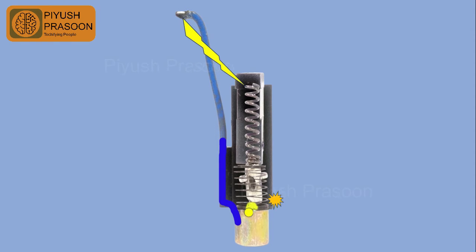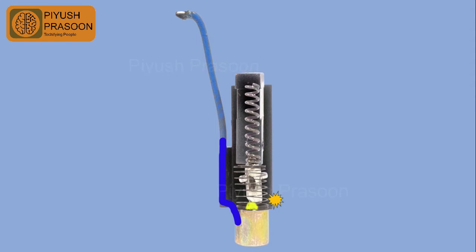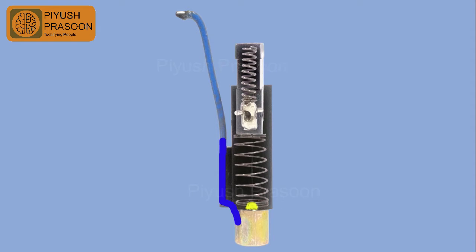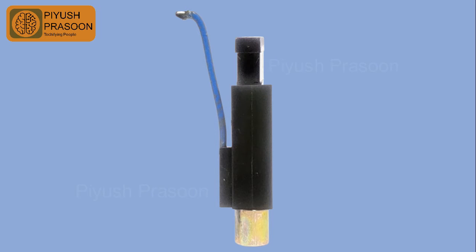800 volts is sufficient to create an electric arc due to the huge potential difference between the two terminals, and as a result it ignites the gas coming out from the lighter's nozzle. The movement of yellow dots denotes the flow of electrons which reach the tip of the wire from the bottom and create the electric spark between the wire's tip and the upper portion of the push button spring. The wire tip is at higher potential and the spring is working at lower potential, because at the same time the hammer attached with the spring is touching the upper portion of the piezo crystal, which completes the circuit.